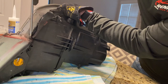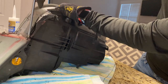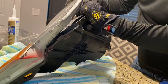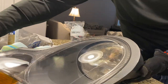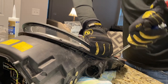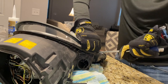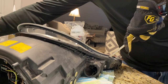Working on the second side, and you can see that the casing cracked right there — another piece just chipped off. I was going a lot faster on this side with a little too much confidence and brute force. Instead of working on the bottom part trying to get that separated, what you should do is go all the way down to the corner on the front side before worrying about the very front part where I was chipping it. Work your way around starting on one side to the other, but don't try to go all the way under the front — come back over here to get this side opened up first.